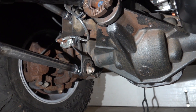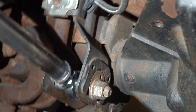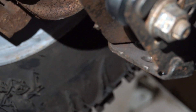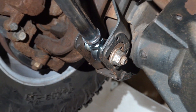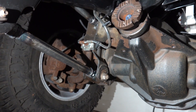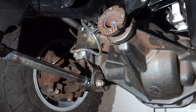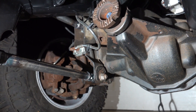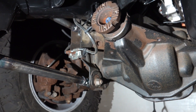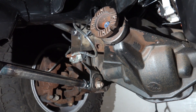We're going to put a plate on the lower control arm mount, grind off a couple of small tabs, set up our plate, tack things in, get our bar roughed in, and go from there. It might take a bit of a process to get everything where I want it, but we're going to get it done — it's going to look good, function well, and it's just another step closer to having this thing ready to go.